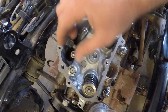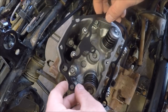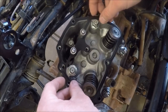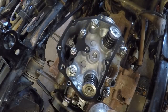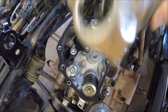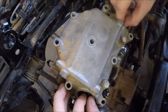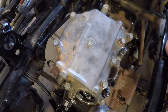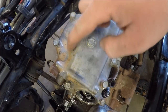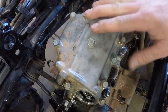Next we'll move on to the motor mount and head — go ahead and put the push rods in. Like I said at the beginning, I marked which was rod one and rod two and marked the top of them so everything goes back in at the correct original spot. When putting on the valve cover, make sure your rockers are not binding up over each other until they fall down into place. Put the valve cover on and check that your dowels fit into the push rod cups.